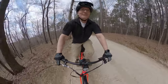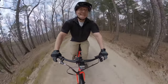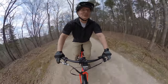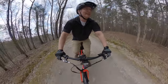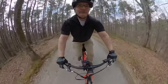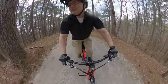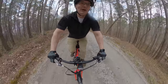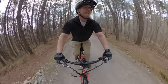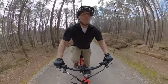The main thing I notice riding on this path is the lack of suspension — not just the front fork, but it doesn't have that built-in cushion of big, fat tires. The brakes are the always-fine 180-millimeter Tektro Ares mechanical discs. Yes, hydraulic brakes are better, but I've been riding multiple e-bikes with these exact same disc brakes, and they are more than adequate for the vast majority of riding that anybody is going to do on a bike like this.